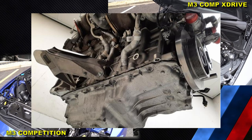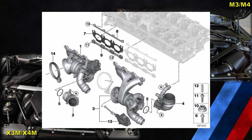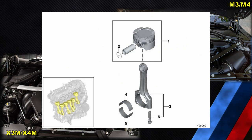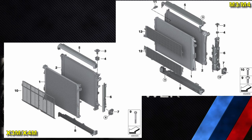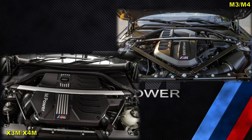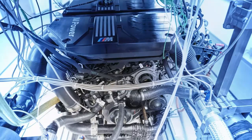I proceeded to compare various parts in the illustrated parts catalog and unsurprisingly found many similarities — for example, same turbocharger part numbers, cylinder head part number, piston and rod part numbers, high pressure fuel pump part number, etc. There are some radiator and tubing differences which can be explained by chassis dimension differences. However, I did find one interesting difference I cannot explain: the crankshaft of the X3M and X4M is a different part number compared to the M3 and M4. As the engines all produce the same power in both competition and non-competition versions, it is not obvious why the crankshaft would be a different part number, so if anyone knows, please do post a comment below.